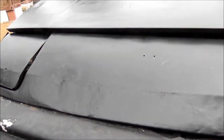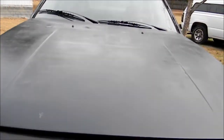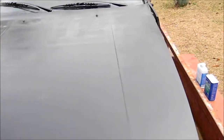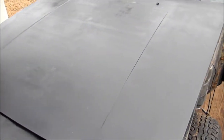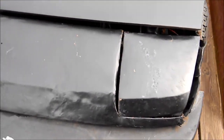It's got a little bit of damage. I took all the bondo off — as you guys might remember, this hood was full of bondo. I took all the bondo off, sanded it down to bare metal, primered it, put some rust blocker on it, and put two coats of satin black on it. It came out pretty good. I did the same with the headlight covers — I took all the bondo off of them.